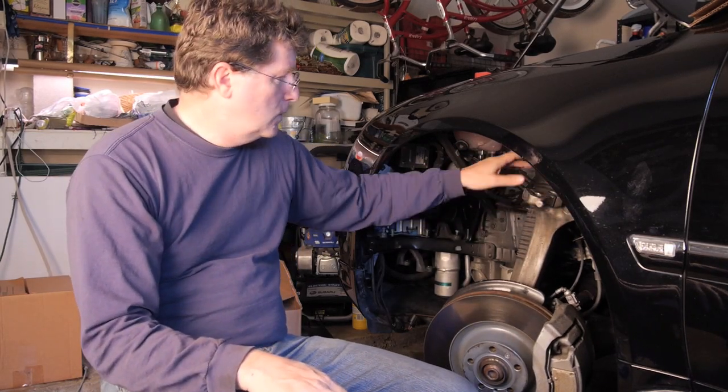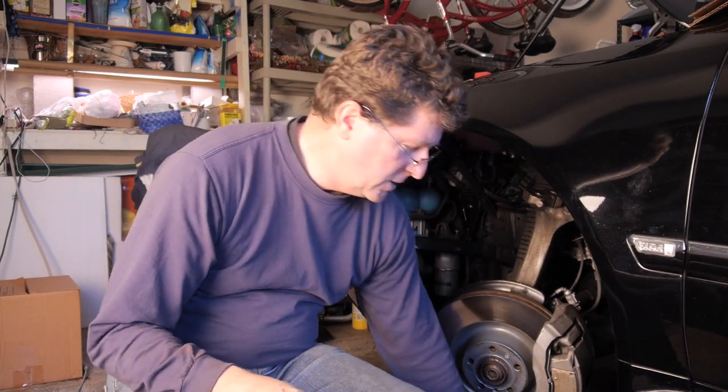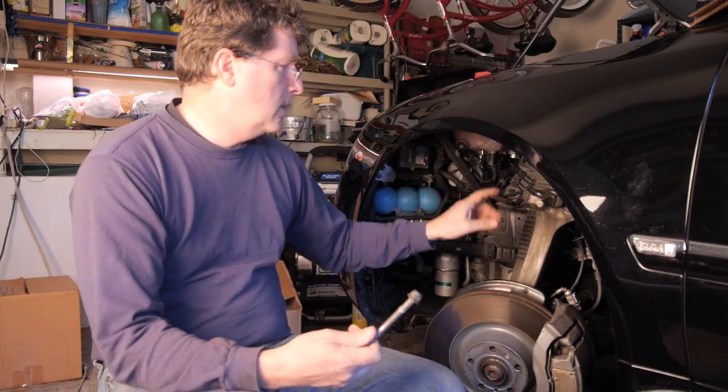We are ready to proceed with taking the air spring out of the car. But let me just update you on what we've done so far. We had to take the upper control arms loose in order to get the air spring out. Now, here's something that I'd like to point out. These upper control arms are attached to the main suspension unit with this pinch bolt right here. Now this pinch bolt is steel, and the control arms and the suspension components are aluminum. So since we have steel going through aluminum, there's a potential for corrosion because of dissimilar metals.